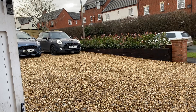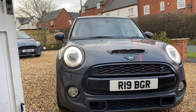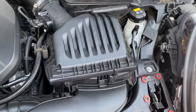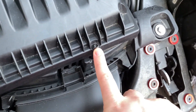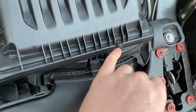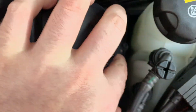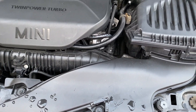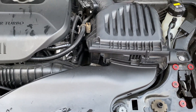I'm going to set the camera up and show you guys how to install this — we'll do a before and after so you can hear what it sounds like. The Mini is currently warming up. The panel filter is located behind here, so you need some torx screws — they're not T20, I'll have a look and see what they are. You've got a torx bolt there, you remove this clip thing here, another bolt there, and I think there's one more in there. We'll let the engine warm up, do a before test of what it sounds like — the wastegate, the turbo — and then do one after we've got it installed.